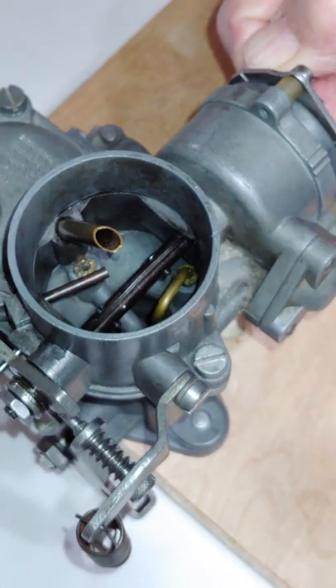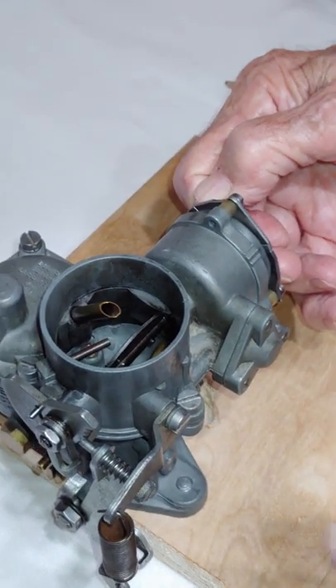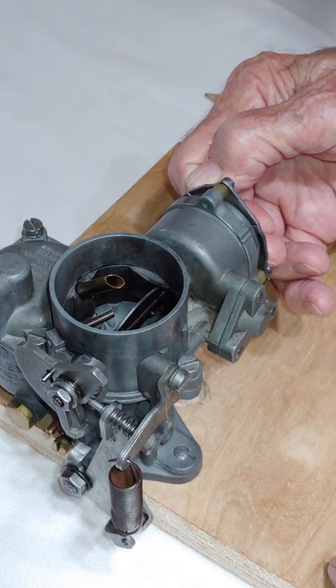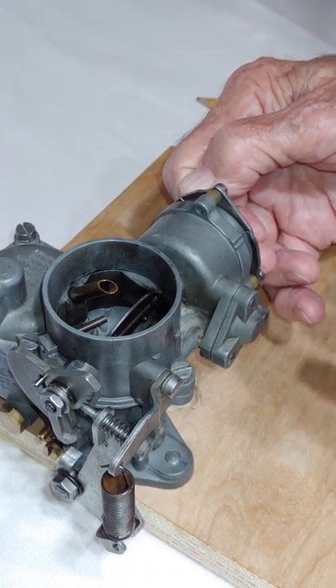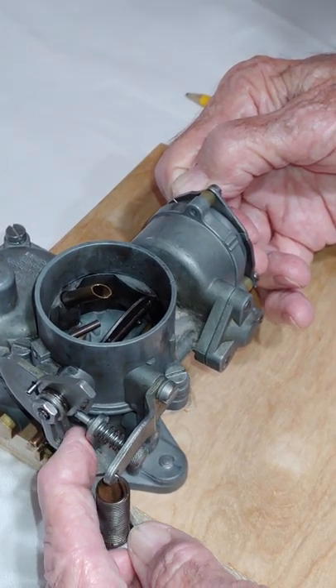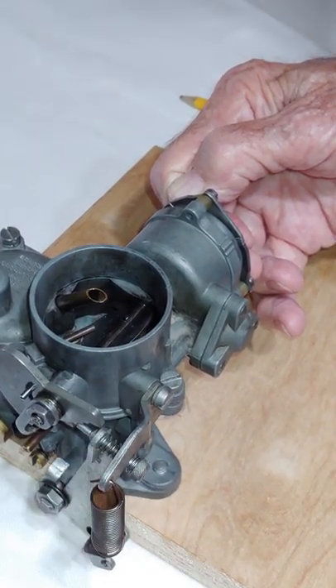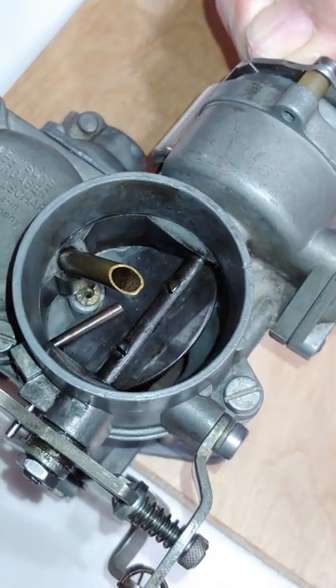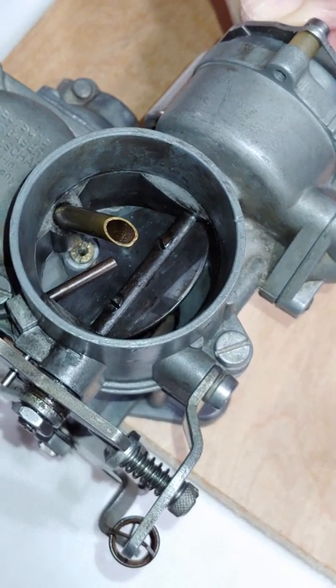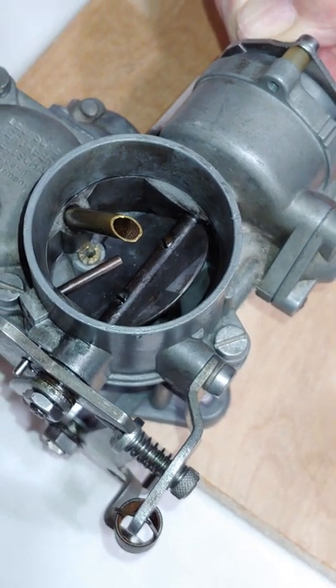When you get out in the morning and start your car, you're going to get in, put the key in the ignition, do nothing yet, then depress the accelerator pedal one time — and when you do, that's what happens: the choke plate returns to its cold setting. Now you're ready to go. You can turn the key to start position and start your car.